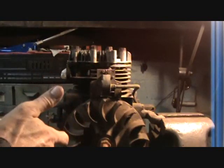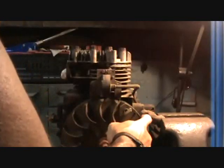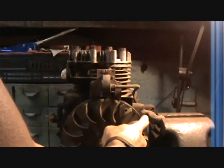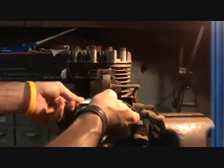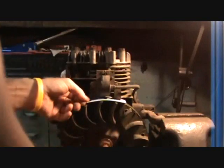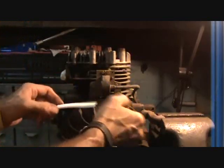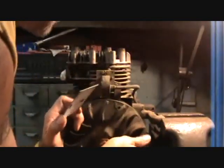Take your business card. Find a flat spot on the flywheel away from the magnet — you don't want the coil over the magnet yet. Slide the card under there, then rotate your flywheel until you get the coil over the magnet. Get it centered over the magnet.